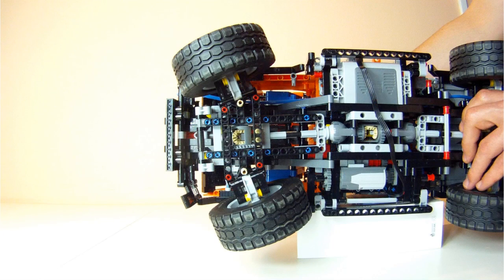The second thing is the pivot point of the wheels, which is very close to the center of the car instead of the center of the wheels. This creates a large lever on which the road can act and makes the car hard to control. In addition to that, the wheels move around in the wheel wells too much and take up a lot of space while pivoting. This greatly increases the forces necessary to steer the car.